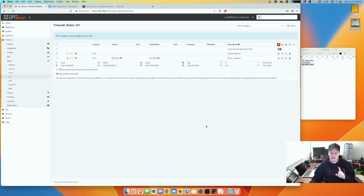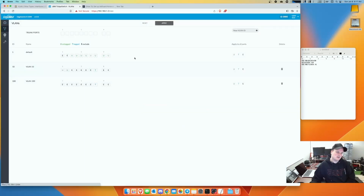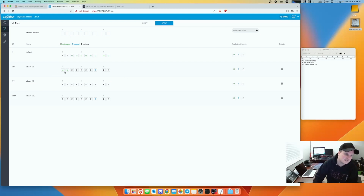We have everything working right now. Let's see if we can get that working first. Let's log into my favorite switch here. Oh, it's already logged in. Okay. So let's go to look at our VLANs. So we should have 10, 100, and we'll add 99. Okay. Port number 1 is going to my test machine way over there. I should be able to see it online, but also get access to it. So let's go with this. Port 1 is sitting at VLAN 10. VLAN 10 should be a 192.168.10 address.